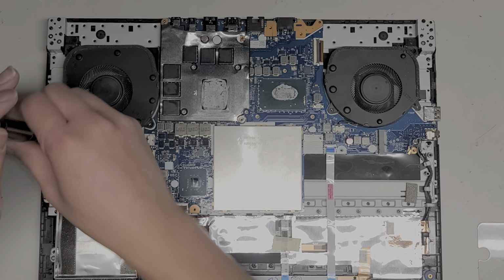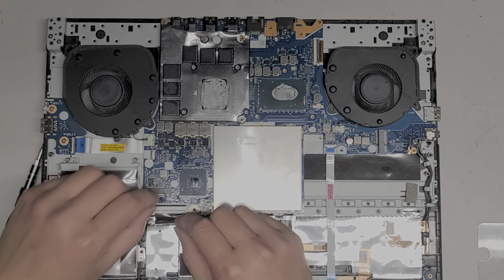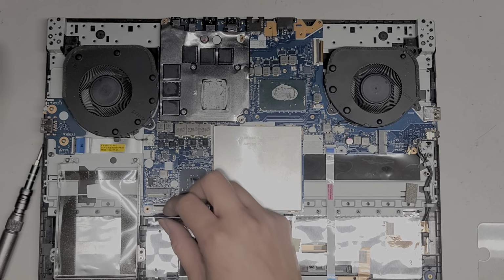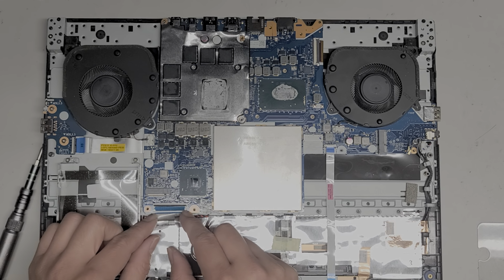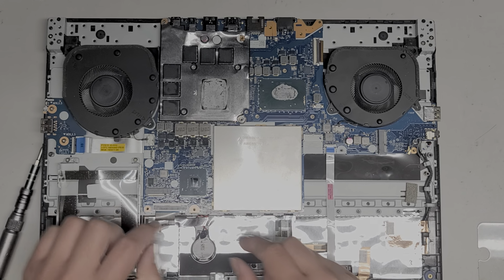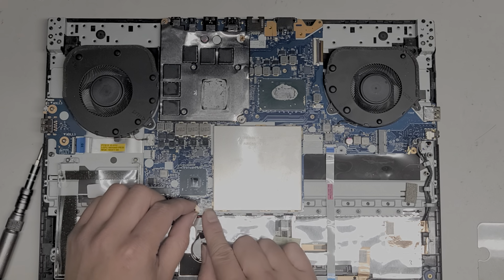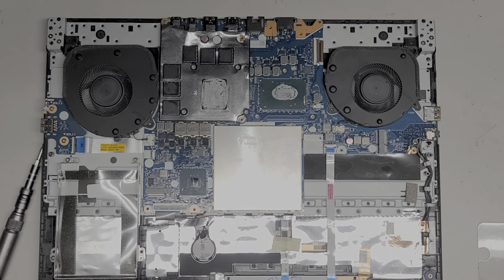Okay. Reattach the keyboard connector here. Little dusty in there, clean that up. All right, get the cable in. Use the blue part to kind of help push it in and push that latch down. CMOS battery. All right, reconnect that. Same thing, pinch the two pieces together.